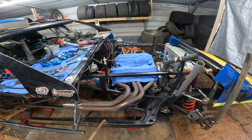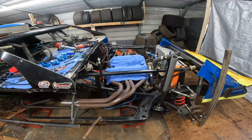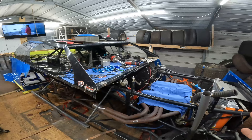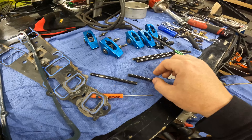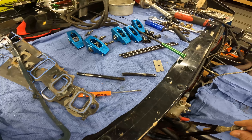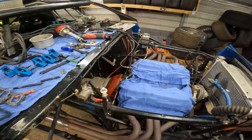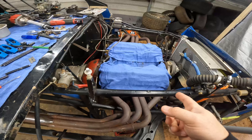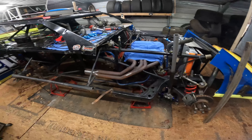Ever since I got it, it had a slight tick to it. I didn't know if it was plugs, lifters, or whatever, so I kind of went through everything. I raced it — got to practice once and raced with it once. Luckily — and I say luckily — when it decided to break, this push rod somehow or another broke while the car was idling. All of a sudden it started making a lot worse noise, so I immediately shut it off. Right now I'm waiting on some more push rods and some guide plates because it messed the guide plates up inside the head — they were in pretty rough shape.